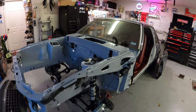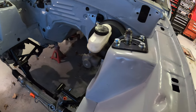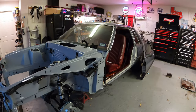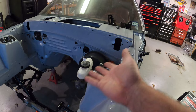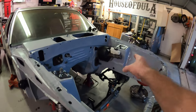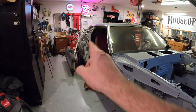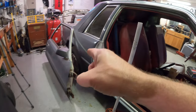Also, we'll be running a standard Cobra booster with a one-inch bore master cylinder along with most likely a standard Cobra rear brake. I talked to Chris from SNS Engineering and he said that's what most people run — your standard one-inch bore master cylinder Cobra brake booster or hydro boost of some sort, and standard SN95 or Cobra style disc brakes in the back as well.